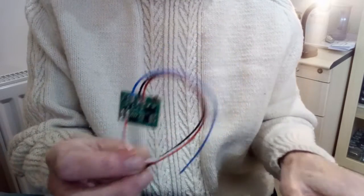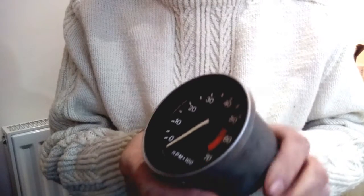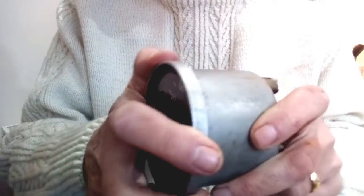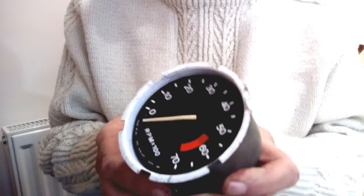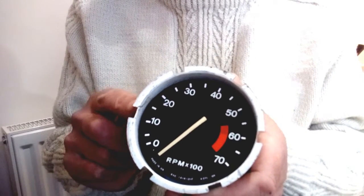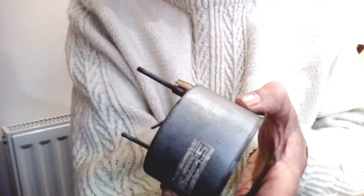So that's a little bit about the Unitaco repair kit — let's go ahead and see how we fit it to this RVC type rev counter. The first thing is simply to remove the bezel, which in this case is very easy — we just twist and line up the slots on the back and remove the bezel. On some tachometers these bezels can be quite rusted and stiff, in which case it's a matter of applying some penetrating oil and very gently levering around the edge with a screwdriver.